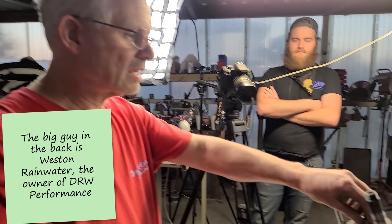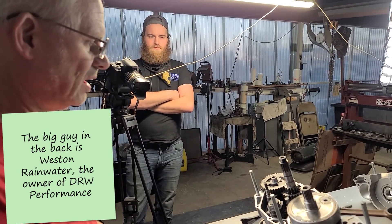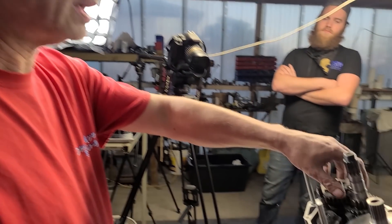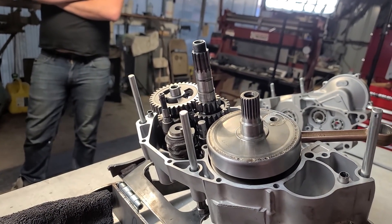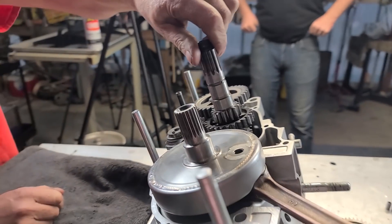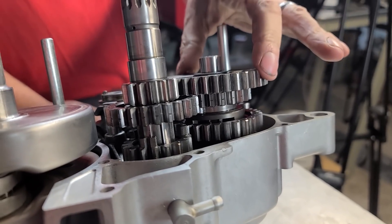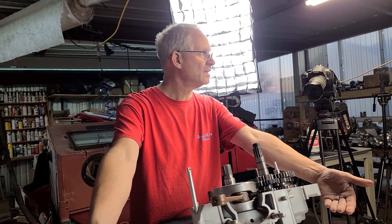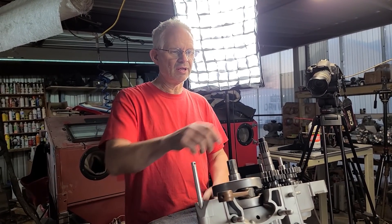Dave, I'm noticing you're not using any assembly lube. Do you recommend it? If you've got a completely dry transmission that you've just taken out of an ultrasonic or it's been chemically cleaned, if you put it back in and start the motor up - even with oil in the bottom end - it's just going to sound rattly as all get out. So if you've got something completely dry, put some assembly lube on it. These gears have already been run and there's some oil left over on them, so it's not something that concerns me. Even if somebody does put it back together dry, you fire it up and it sounds rattly - you've got oil in the bottom end, lay the bike over on this side for a little bit, then bring it back down and fire it up and it'll be fine.